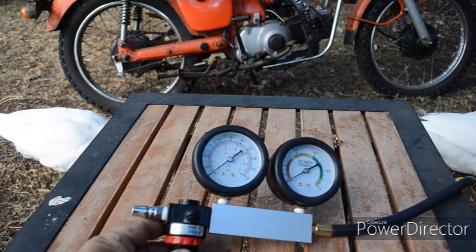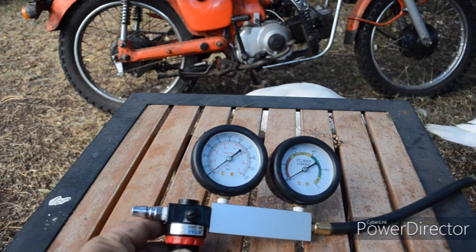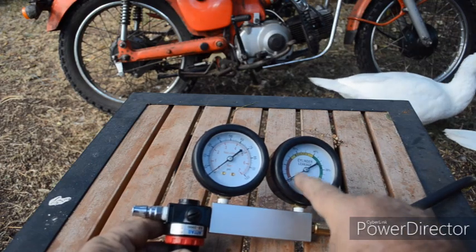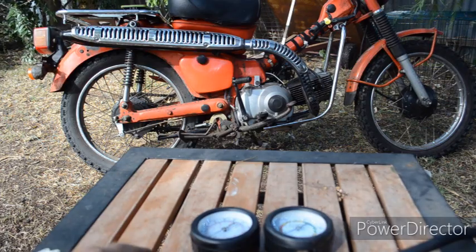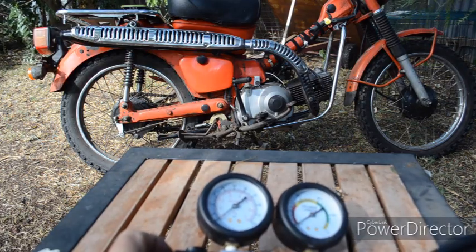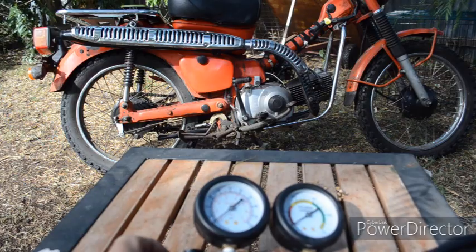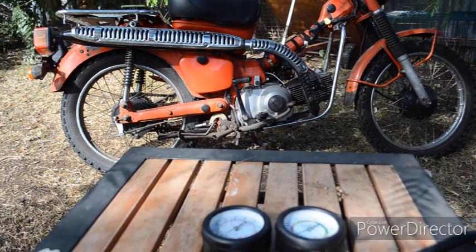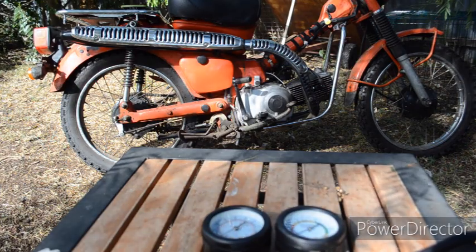Overall, this cheap nasty tester is pretty much a waste of money unless you're just going to use it as a means of supplying air without relying on the gauge. A leak down tester can be a good addition to your tool kit, but buy a decent quality one. Don't buy one of these generic ones — I tried fitting an identical gauge and it simply rose and fell in sync, so there's no metering happening inside. It's pretty much worthless. Thanks for watching, thanks for your support, thanks for all the subscribers, and I'll see you again soon in the next video.